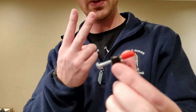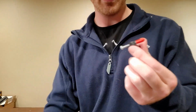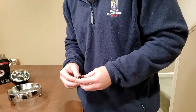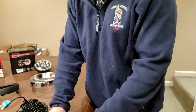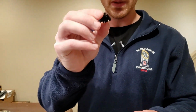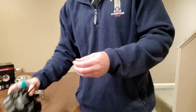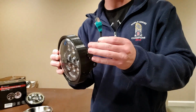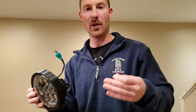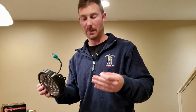Now you're going to do this 2 times. There's the front, there's the top and bottom adjustment. After you've completed that, we can put the lock ratchet on. What this does is keep this clamp ring in the same position that you had tightened it down. So during normal riding and vibration and all that stuff, it will never loosen up.